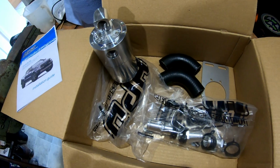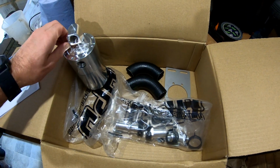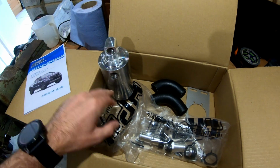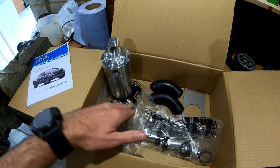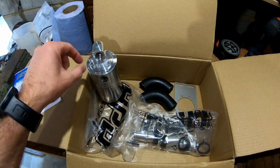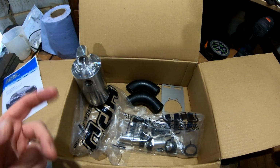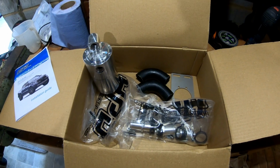One, because then you don't have to continually change a filter. Two, I really liked on the HPD one that you have this oil dipstick, so you can easily check what the level of oil is that gets captured inside, to know when you need to empty it. And although there are some gauze filters on both sides of the inlet and outlet, they can be easily removed and cleaned, so there should be no requirement for replacement parts with it, which is one of the key things that I liked.